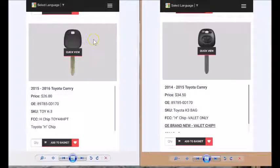And we get this all the time on the tech line. And people say, well, I have the right key. And they'll say, oh, okay, what's the part number? Oh, I'm telling you, I have the right key. No, it's not going into the system. The light is solid, which is a verification that you reset the immobilizer. They try to reset it again. That fails because you can't reset it again. Once it's reset, that's another golden rule of Toyota.